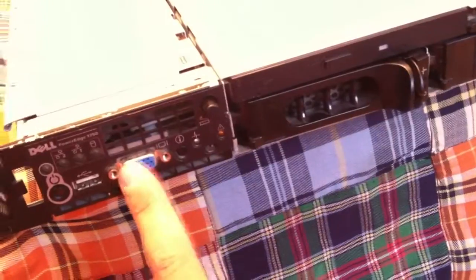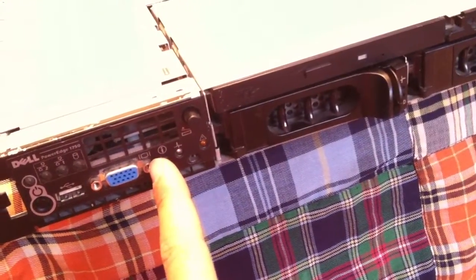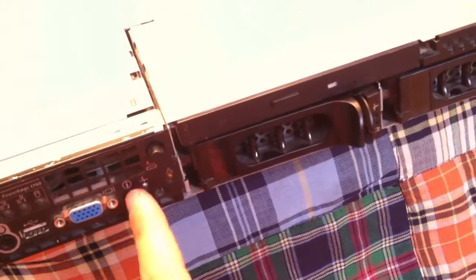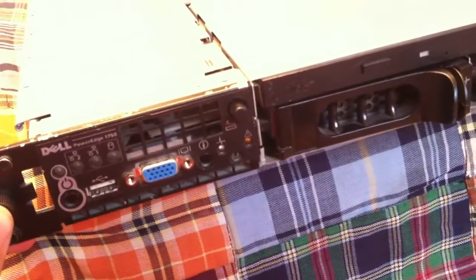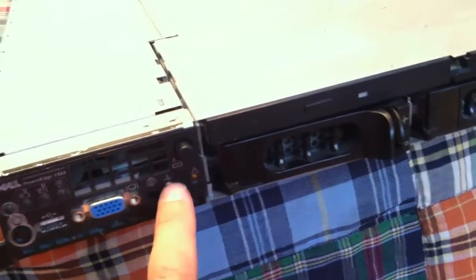Really nice part is the VGA port on the front. I also did a tutorial series on the SC-1425, and that's another thing I kind of miss. VGA port on the front is great — I love having those. There's your little indicator light button. That's basically to indicate this server in a rack. If you have a ton of these and you want to work on one, you start at the front, go to the back, and go — holy crap, which one was I working on? That's what that button is for.